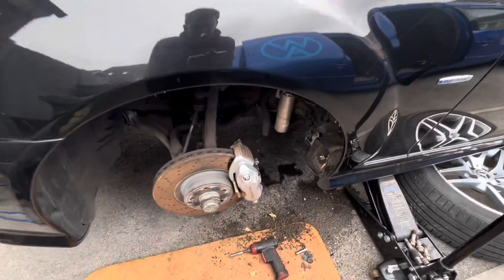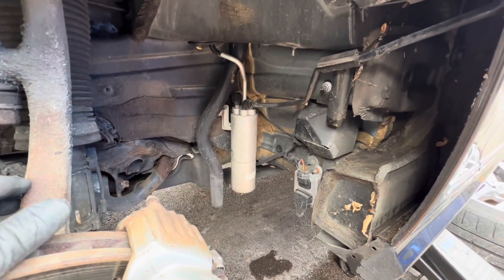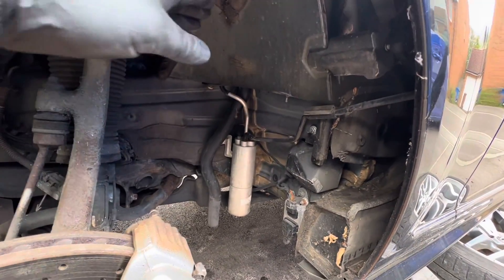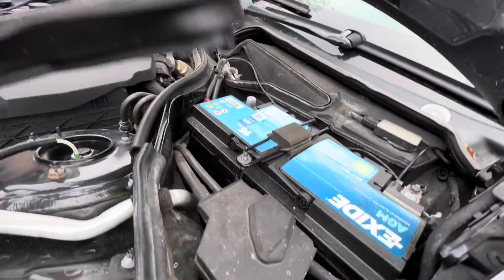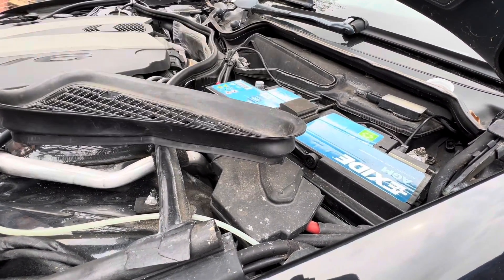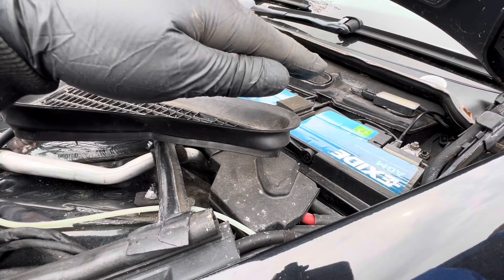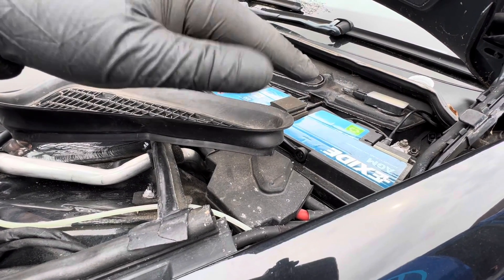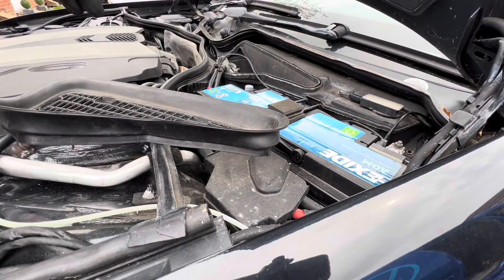We've taken out the back half of the wheel arch liner on the passenger side as well. The passenger side is where we had the actual issue with water ingressing in, but it could also be caused by the other side. So even if this side's not as blocked — if the water's backing up into the battery tray under here and around the electronics, and the car's sitting tilted to this side — it backs up high where the air intake goes in for the interior compartment to the blower motor. If it backs up against that, it's only got a sponge seal, so over time it'll seep through because it's only a splash seal, not a submergible seal.